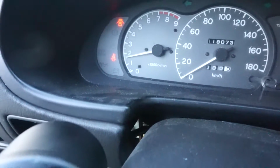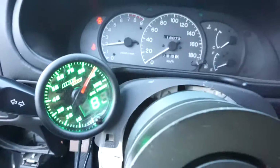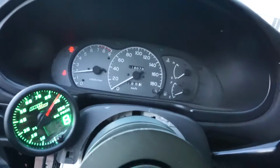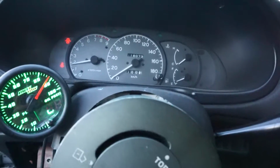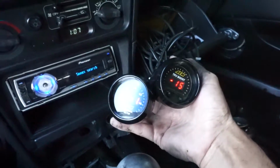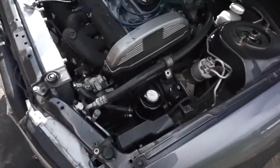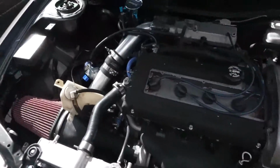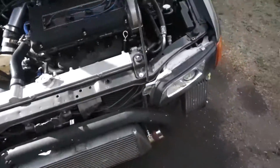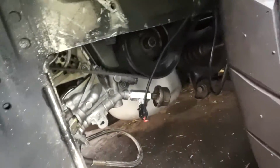I'm going to do this for about 2,000 RPM, maybe 2,500. And I'll check for leaks right now once it warms up a little bit. Alright, got her up to temperature. Oil pressure dropped because it's at operating temperature, which is a good thing. No leaks. Still a little rough on the idle. I'm not worried about that as long as it runs. No leaks. Running fully.